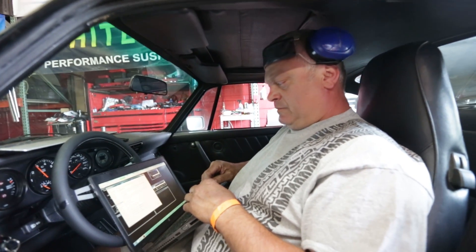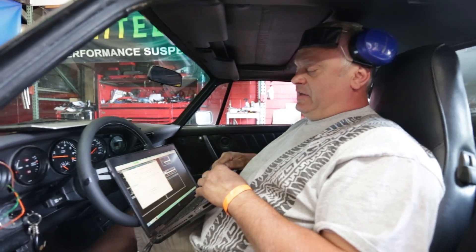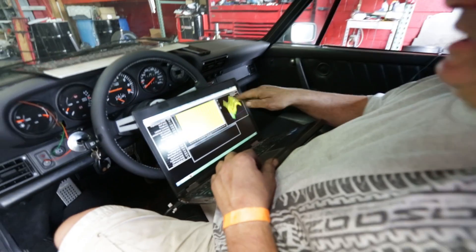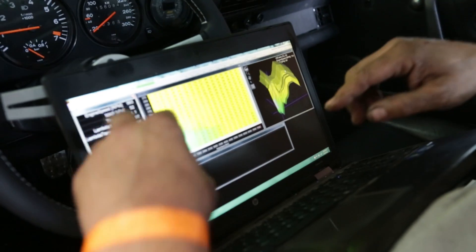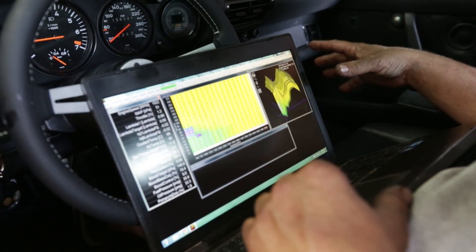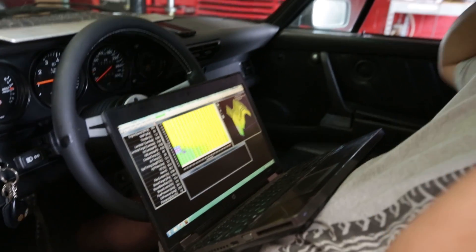Walk me through what we're going to do here, Tony. So we got the new turbo installed — what changes do you need to make for tuning? The power curve is likely going to go flatter and carry better up top. There's enough closed-loop control to fix that. I'll go back to wastegate boost, make a hit, log where the fueling goes, and trim the fueling based on that.